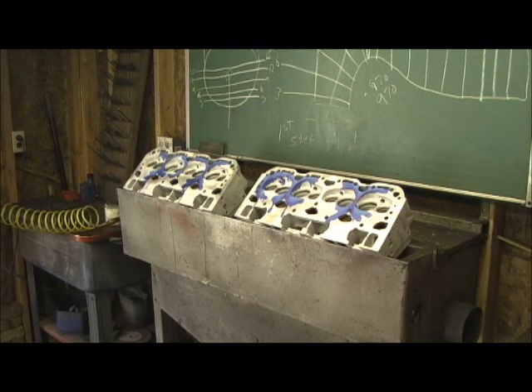On the plate here is the 1993 Chevrolet LT1 heads — the reverse flow coolant heads. A customer named Tom sent these to me, and what I'm going to do is make this head outperform even the LT4 or the Edelbrock head. We're going to do this by basically a total runner reshape and by putting the tubes in the heads.